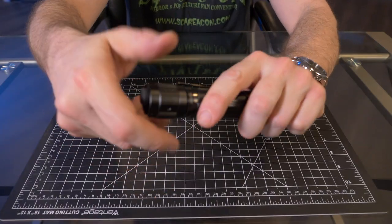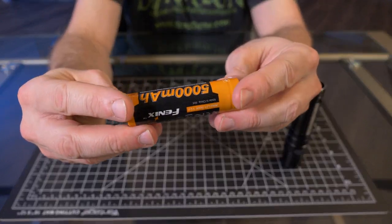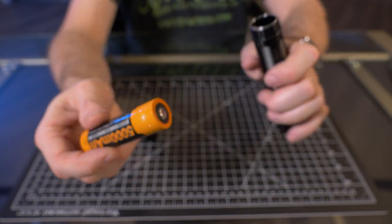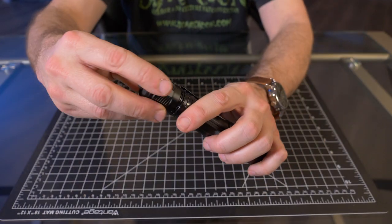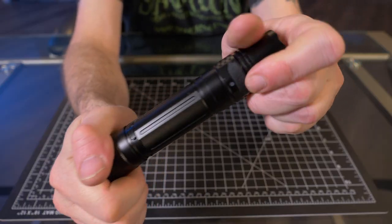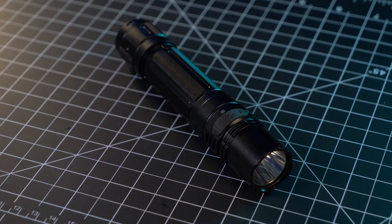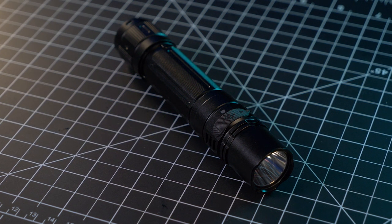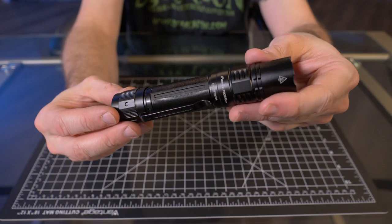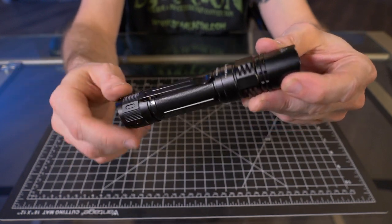Let's break open this tail cap and take a look at what battery comes with it. It is a 5000 milliamp hour 21700 3.6 volt lithium ion rechargeable battery. This can be charged through the outside USB Type-C charging port, or it can be externally slot charged, which is my preferred way of charging. With the tail cap on tight and the USB Type-C charging port sealed, it has an IP rating of 68 — the 6 means completely dustproof and the 8 means submersible in up to six feet of water. It also has one meter impact resistance, and it comes with a lifetime warranty from Fenix.